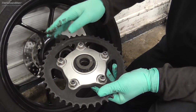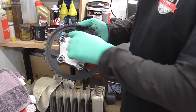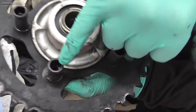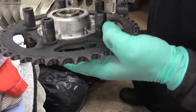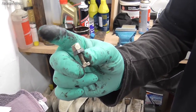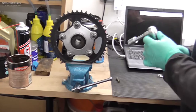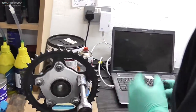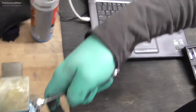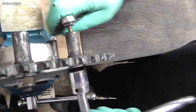So now what we need to do is put this sprocket in the vise because we need to take this plate off. We need to remove the sprocket off this sprocket carrier. On the back, these lugs locate in the cush rubbers. There is actually a 10mm Allen key socket needed because when you undo these nuts these will spin. I haven't actually got a 10mm Allen key with me today, so I've had to improvise — I've got a 10mm headed nut and I've put two nuts on it, and that should enable me to hold it enough. You need a 17mm socket. Hold that like that — and because I've locked those two nuts together, perfect. So we'll just undo those.